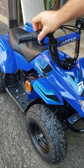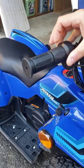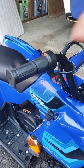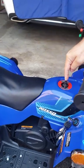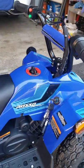If your ATV is clicking like this but not moving — you're holding the throttle handle and it's not moving — it can be a problem with the forward, neutral, and reverse switch, or it can be a problem with the overheating relay. I'm going to show you how to test both of those parts.